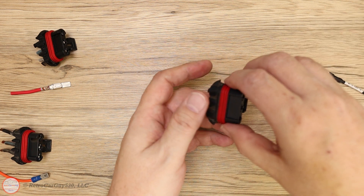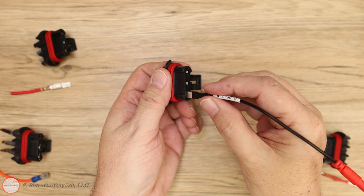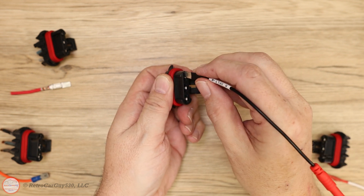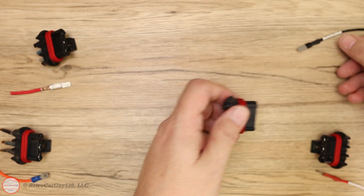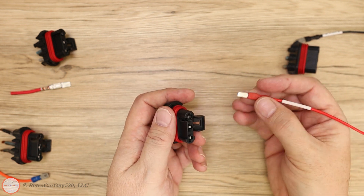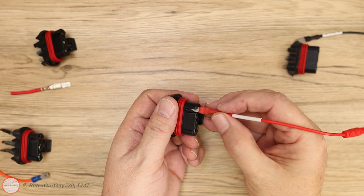I have my AES Wave test kit here with a couple of terminals where I can replicate that same behavior. Tension on the first. Tension on the second. Absolutely no tension going in and out on the third. So that's another example of that. And with a slightly smaller male spade test terminal from the kit, with the melted connector, there's obviously absolutely no resistance whatsoever.